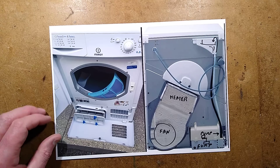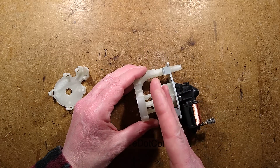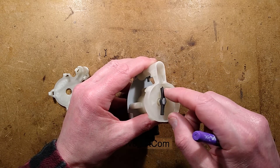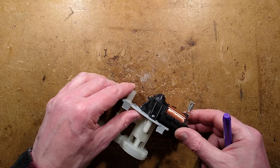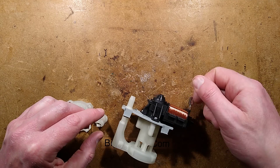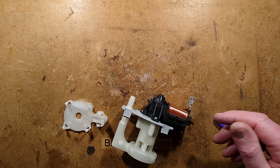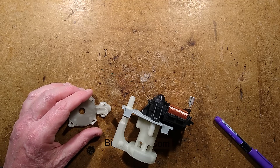By far one of the most interesting bits, apart from the condenser, is the construction of this pump — it's designed to operate within a known water level, keeping the motor out of reach of the water, and just run continuously even if there's no significant amount of water to pump. It's an interesting, super minimalist design — just mass produced and cheap. There are only three motors in the machine: one for the drum and the two fans, one for the pump, and one for the timer or electronic controls that counts through the cycle. Interesting special purpose pump component.